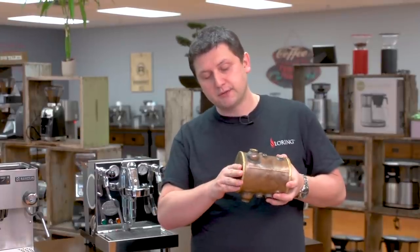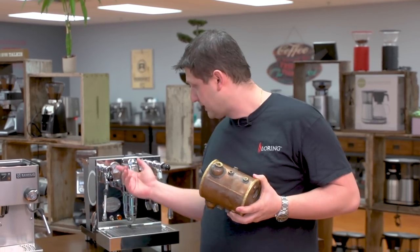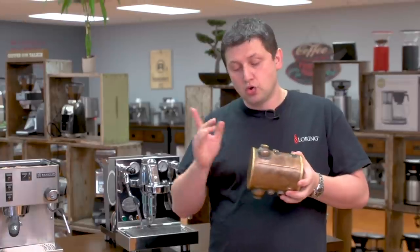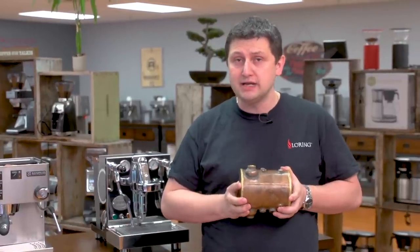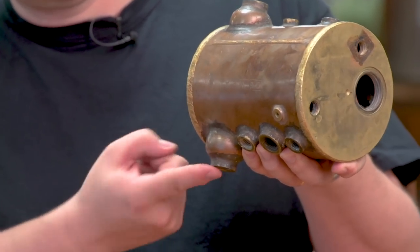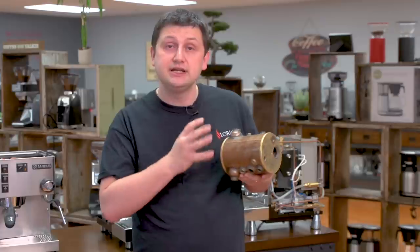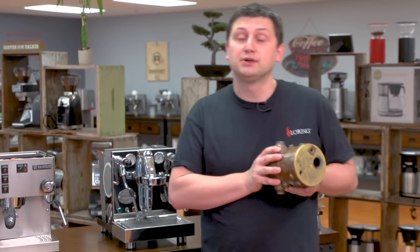So the boiler is filled three-quarters of the way with water, that water is boiling. When I want to steam, I just open a valve and steam comes out — I can froth my milk right away. When I want to make a shot of espresso, it pulls water from the cold water reservoir. The pump comes on and the cold water comes either from your reservoir or from the water main if it's a plumbed-in machine. It passes through a heat exchanger — right here — through the bottom and out the top. The diameter and distance of this heat exchanger has been precisely calculated to yield a certain temperature. Heat exchanger machines are very stable when it comes to temperature and capable of producing great drinks, and you can froth steamed milk and make espresso at the same time.